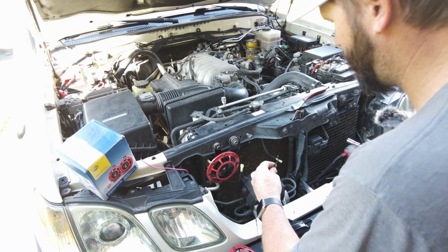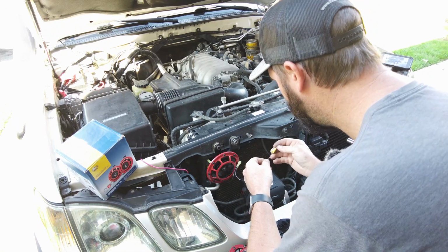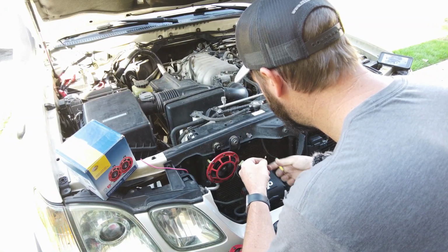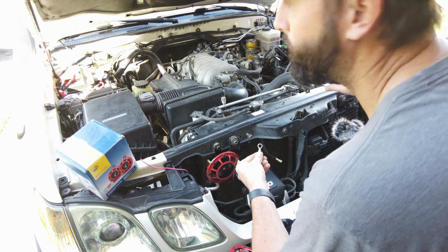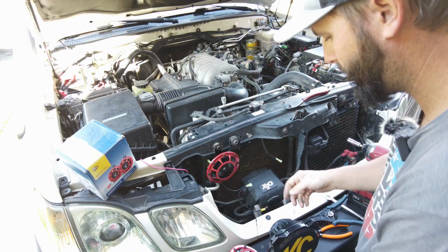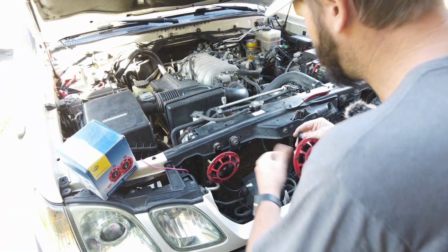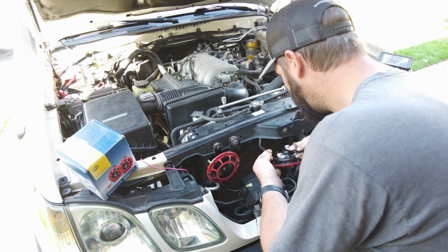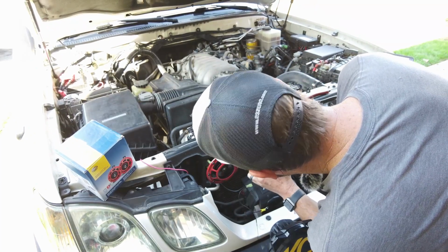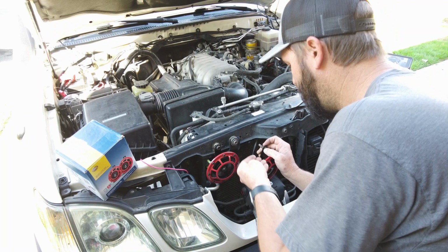And then we're gonna strip a little wire back and install our ground eyelet. And I'm gonna go ahead and put a slight bend in that. Easy. So we're going to grab our bolts and washers. Simply go in there. And same type of thing. So the power is going to be, in this case, on the top, and ground on the bottom. And we're going to go ahead and put a couple washers in.